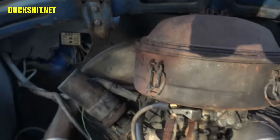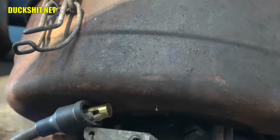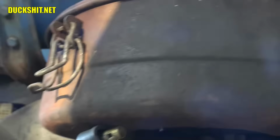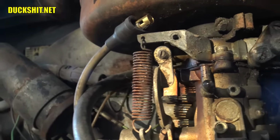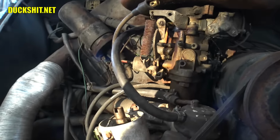All right. Do this now. Turn the key on and go ahead and crank it. Okay. Until you tell me to release? Correct. All right, stop. We got spark. Woo-hoo. That's good. Good news. And I smell bad gas too, so whatever is blowing through the system is finally starting to come out.